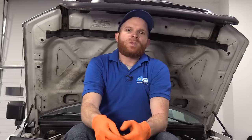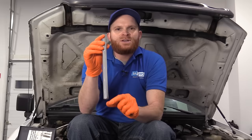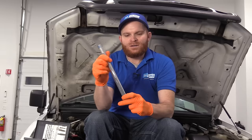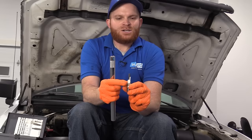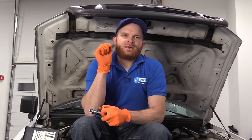The other issue you might notice is especially on the Triton with the three-valve engines — it's a different type of spark plug, and the spark plug doesn't want to come out. When it comes time to replace those spark plugs, you're going to have to use a specialty socket — a nice extended socket that gets down deep inside those tubes that lead down to the spark plug. That way you have a good grip and it won't flex around, because if you use a smaller socket with a big extension, you could flex it and potentially break your spark plug.